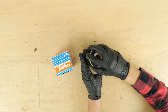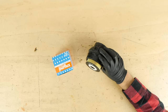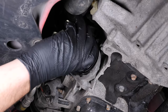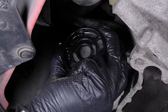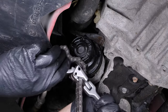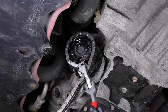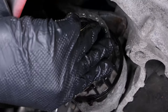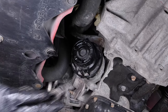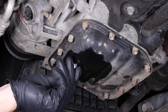Insert the new filter into the flange until you hear the click that confirms it has been locked into place. Screw the filter in place until it makes contact. For the tightening process, use your chain spanner. Be careful — with this kind of oil filter, the new joints can be excessively thick, making the tightening process more complicated. Ensure that the flange washer is flat against the oil filter housing. You can also use a torque wrench set to 25 Newton metres. Replace the drain nut with a new one, then screw the drain nut back in.